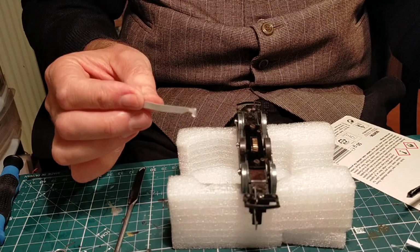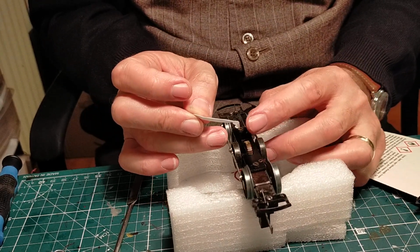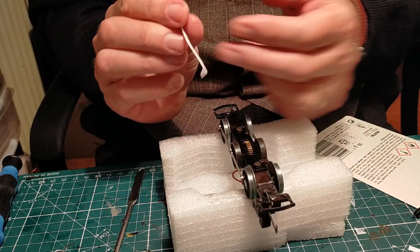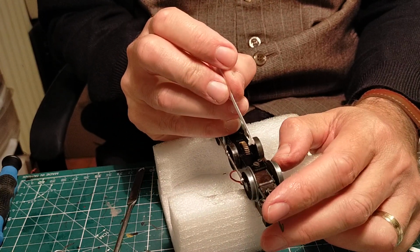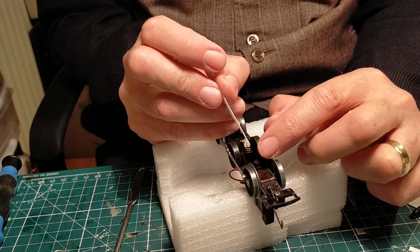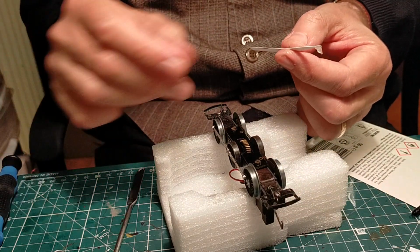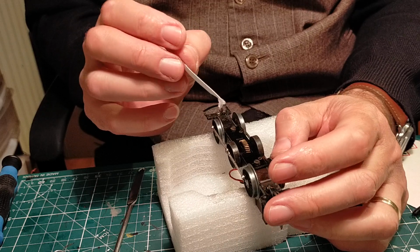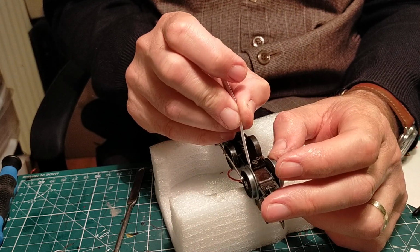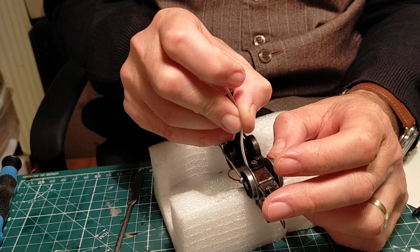and then go in between the wheels and the chassis so that we make sure this stuff then gets sucked into the axles. Because there are no axle inspection hatches cut out in the chassis in this case here. So I'm just going to go right in like that and pack my technical petroleum jelly in there.